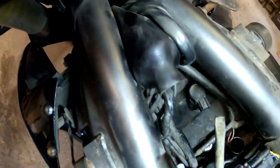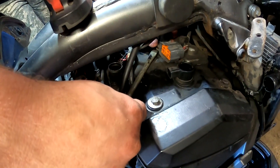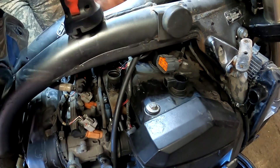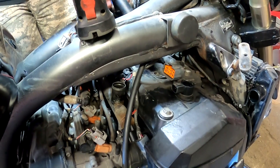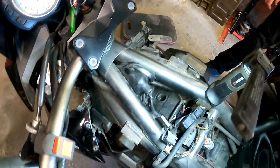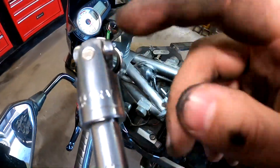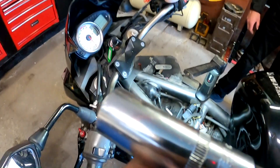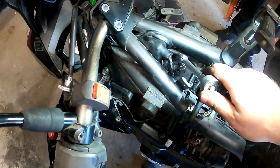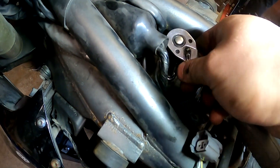In order to pop this coil back out, use a long screwdriver, place it between, help with a finger, and apply pressure a little bit as it comes out. The bigger extension did not fit, so I made this kind of custom setup — a 3/8 to 1/2 socket adapter — in order to reach this spark plug. Now you can see it goes nicely past.